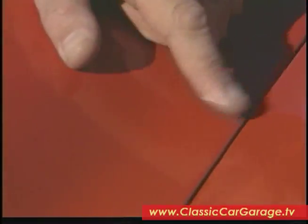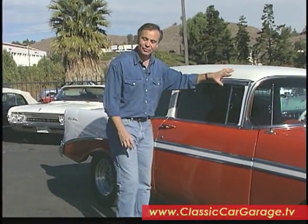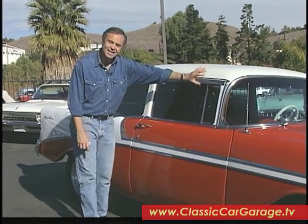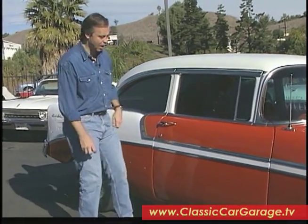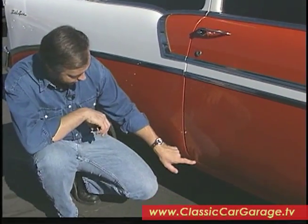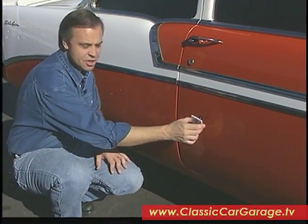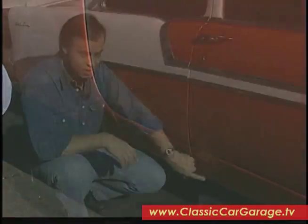Now that we know all the trim is there, the next thing you want to do is take a look at the seams on the car to make sure they're roughly even — such as where the trunk meets the rest of the body, and the doors too. This is pretty even, which would indicate this door has really not been tweaked too much. But up here at the front, this big seam versus a very tight seam, and this little chip, might indicate a problem with this front fender that may need to be adjusted. The body panels don't fit perfect, but not to worry — this is a '56, not a '96. Next thing is to check for rust or body filler. A simple magnet is all you need — stick it on the car all over. Wherever it sticks, you know that's sheet metal; wherever it doesn't, it's body filler.